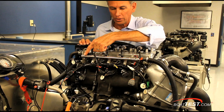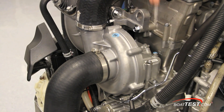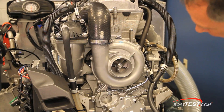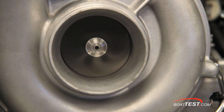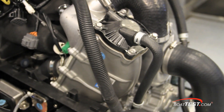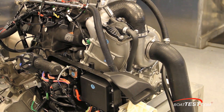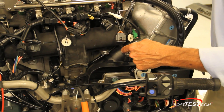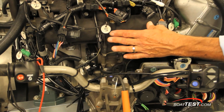This is the stainless steel fuel injection rail. Right here is the gear-driven turbine-style centrifugal supercharger. Intake air enters the compressor body at the center, is increased in pressure, and exits here at about 200 degrees, going down through the intercooler. From there it leaves the intercooler, having been cooled to about 100 degrees, and goes up through the electronic throttle body, where it is then fed through the intake manifold to the four cylinders.